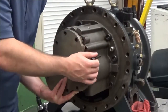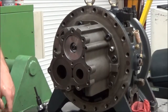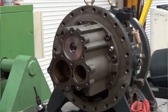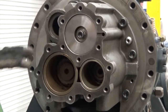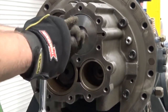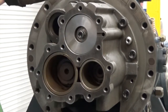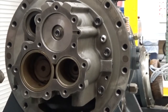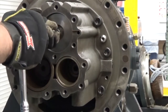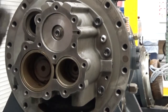Remove the discharge cover plate. Take out the disc springs. With the discharge cover removed, we're going to check the slide piston and valve motion by pressing in on it with a hex wrench and releasing. It should come back at least 75% of the travel, but in some cases due to a worn out slide piston, it'll spring all the way back out towards you. The important part is to see if you can push in on the piston — if you can't, something might have caused the slide valve to become jammed.